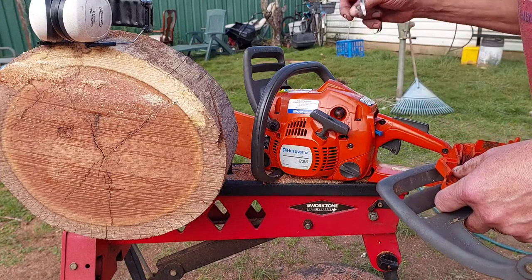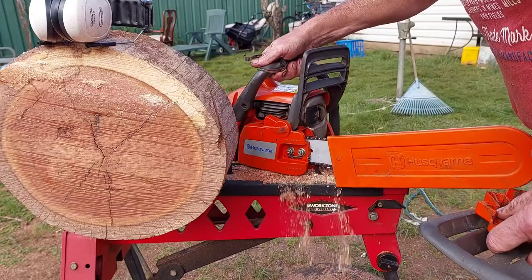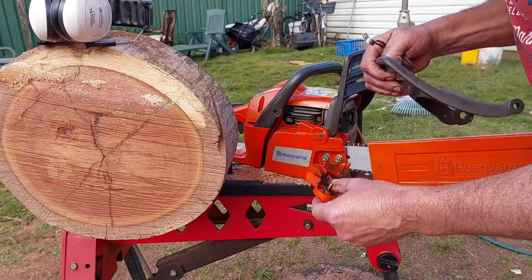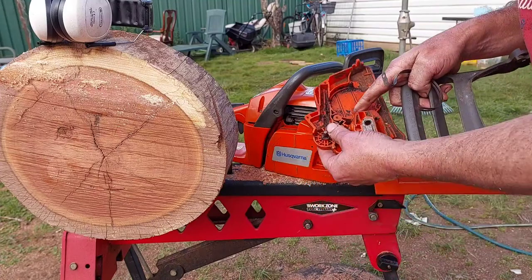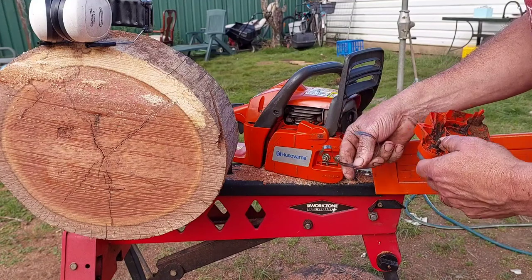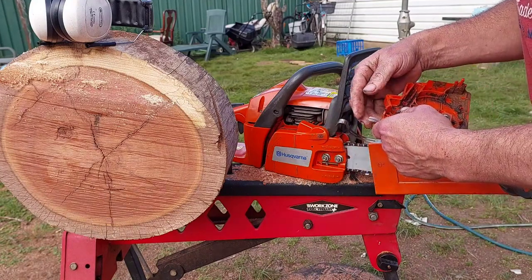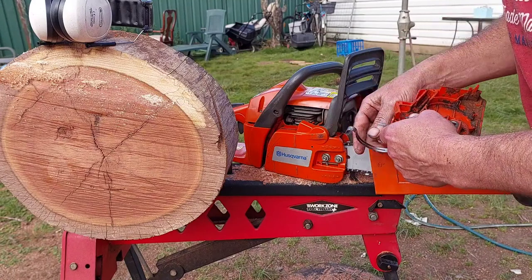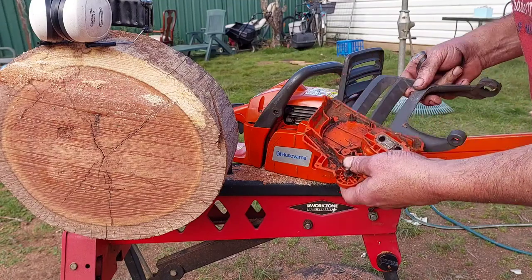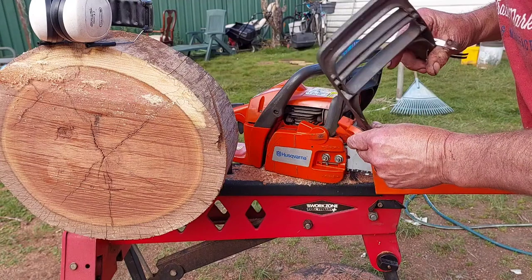But anyway, it also had a problem with the chain brake. The chain brake on these ones is on the side of the cover, if it goes like that. I had to pull the chain brake out of this one here, because the chain brake that was in this one had been cut by the owner, and the parts that were cut did match up, so someone had come in there pretending to snap it off. So I couldn't line this up, and I couldn't for the life of me unlock it. Normally you can line up just enough to put this here and unlock it, and that's it.